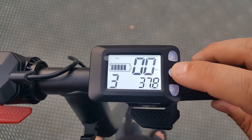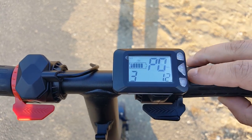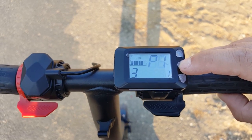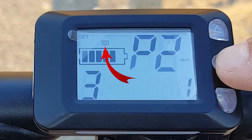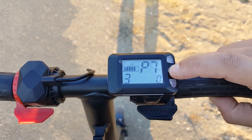The scooter has a few programmable features. To access them, press and hold the top and bottom button until P0 comes up. P0 is default to 12. P1 is to change miles per hour to kilometers per hour. P2 is to turn on and off a scooter symbol — if you know what the symbol is, feel free to let me know in the comments. P3 is to turn off automatic start. P4 through P9 are default so you won't be able to change any of those settings.